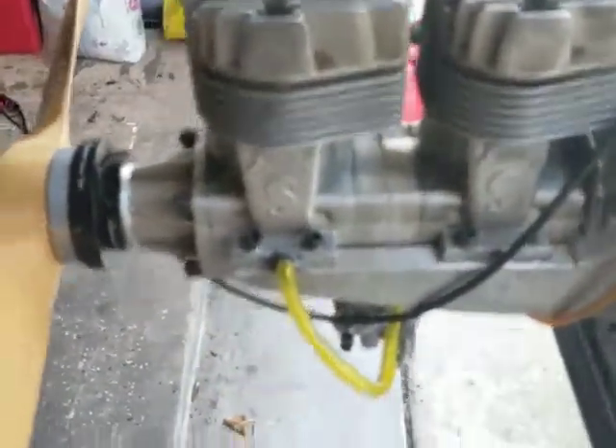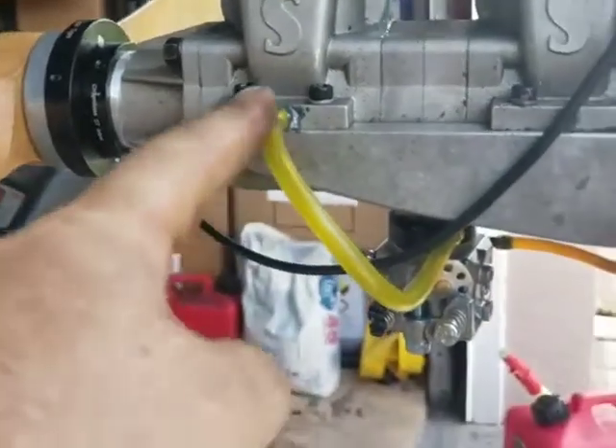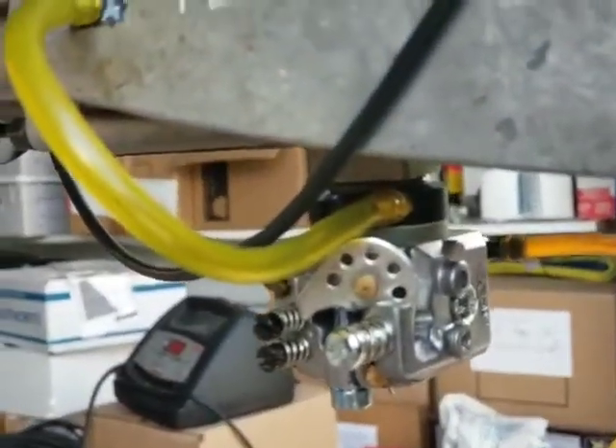One of the things that needs to be done to ensure that the pump is going to pump — I have the pulse line right here that is hooked up to the carburetor holder.